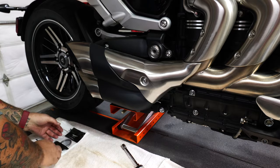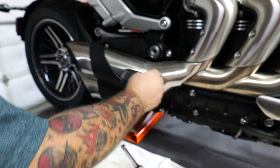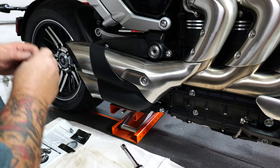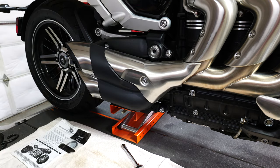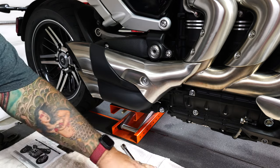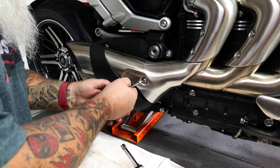First thing — make sure it's cool. I had it running, so I had to let it cool down a little bit. You're going to take off this heat shield and that is a T30 right there. So we're going to put an extension on it to get me away from it. And like always, I have towels down and all my parts laid out. Then we'll just take this guy off.